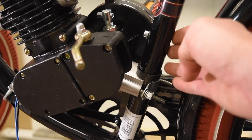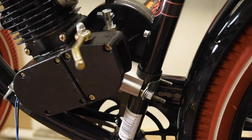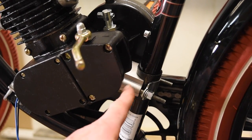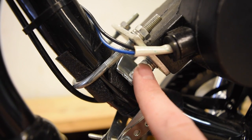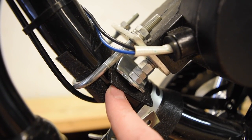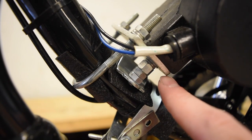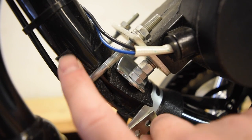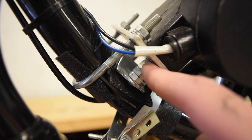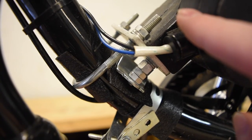I've gone ahead and put the motor in. Right here is the seat post. There were two little screw holes that allow for a cup holder to be screwed in there — I had to remove one of them because the motor sits right there. I used a piece of foam to wrap around the post so it didn't get scratched up, and that's going to stay in there permanently. Right here is the front post of the bike. There are two bolts that stick out of the engine that you use a strap to strap around the post. My post was too fat to use those bolts, so instead I bolted on the metal plate included with the kit and used a U-bolt which allows it to fit around the fat post. I threw in some washers and nuts to lengthen it, then used the plate to rest it on the post itself to take pressure off the engine.